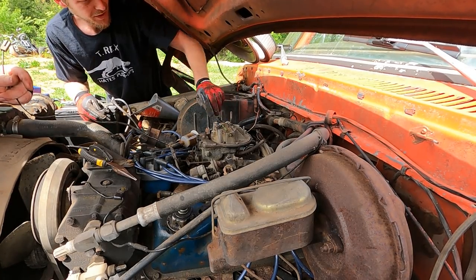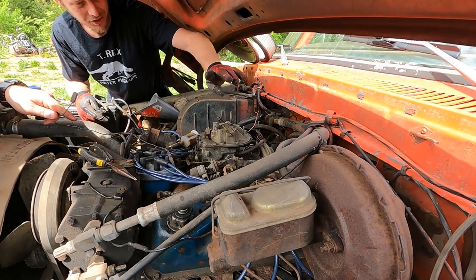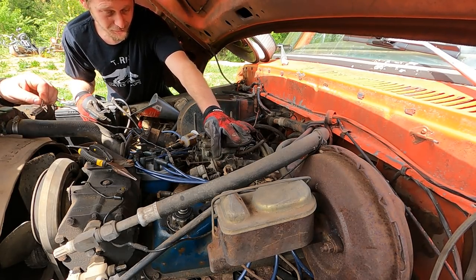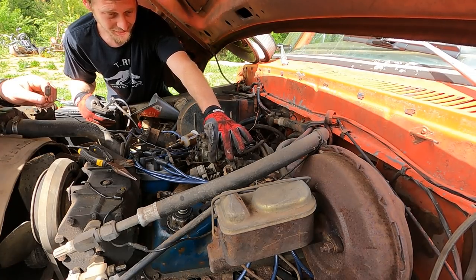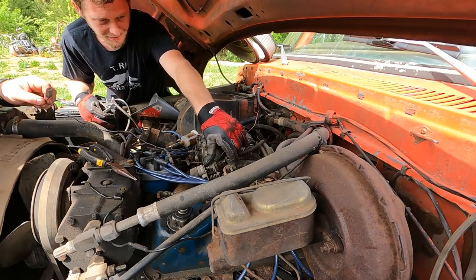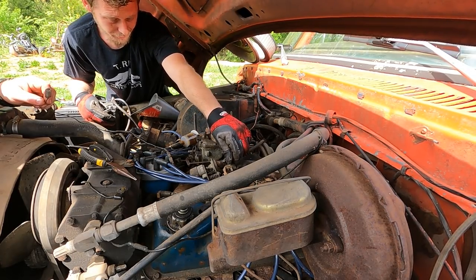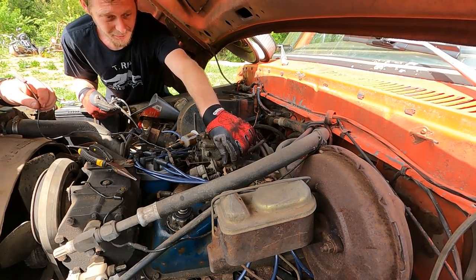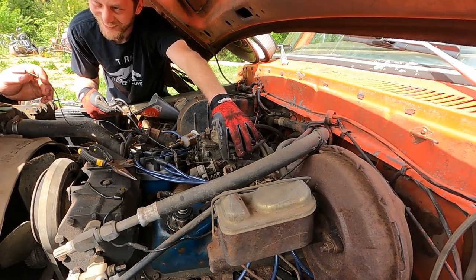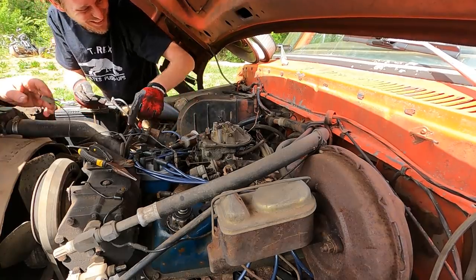Who'd this plug up to? This plugged up there. Oh, okay. I don't know if you need this. I know that if it was an air-cooled Volkswagen, you'd absolutely need it. Because on a Volkswagen, when that throttle snaps back, that slows it down, and without it, the Volkswagen would just die. Yours, it seems like it's not even working. It's not even touching the throttle anymore. So you may not need it.